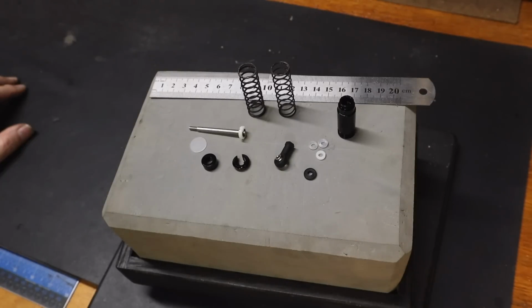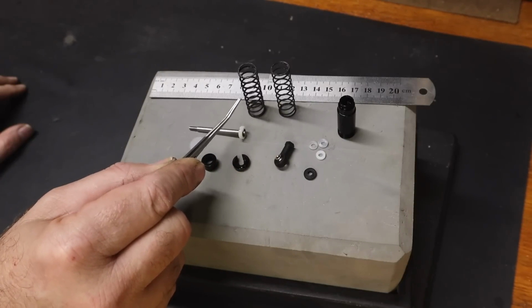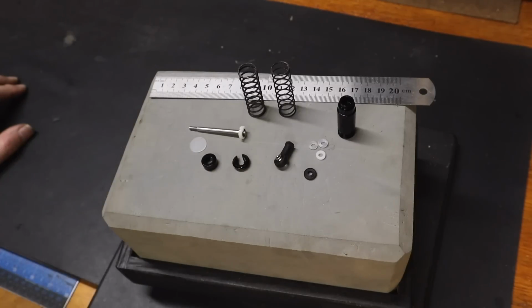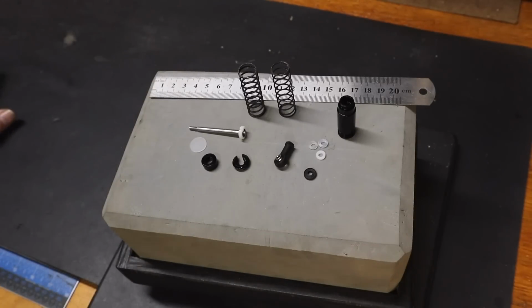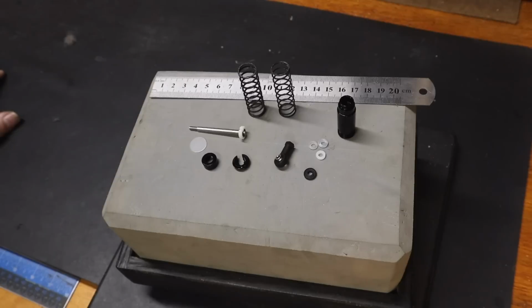11.5 millimeter ID and a 13.5 millimeter OD on this one and a 14 millimeter OD on this one, which is 1 millimeter coil, roughly about a 1.2 millimeter coil. They both have 9 coils. The softer, big air quotes on softer, is 46 millimeters long, and this is 47 millimeters long. Now, this might jump out to some of you because Dravtech's Mini T's, Element, Enduro SE, all of those springs are 10 millimeter ID, which means they're not fitting over that because that thing is 11.5 millimeters, so it is almost interference fit.